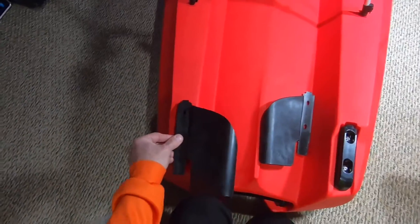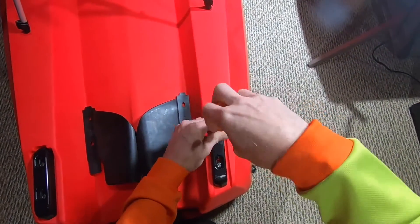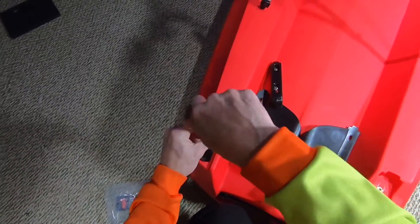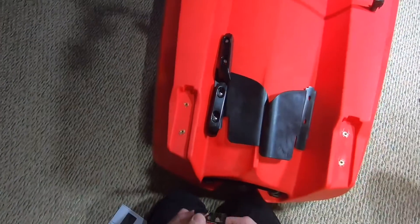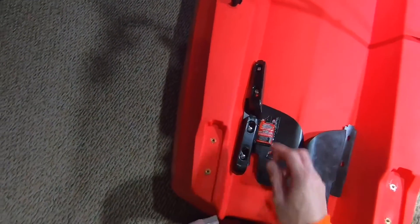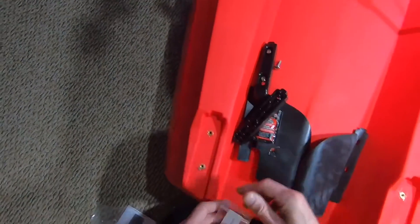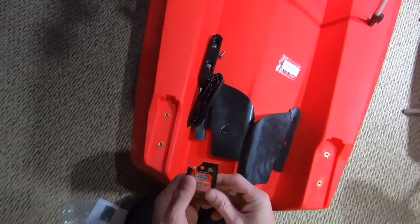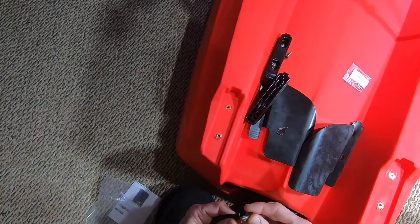The orientation of this is going to be just like this. So let's take off the skid plates. They come off very easily. So now we've got these off. I'm going to use some Never Seize. In the package they give you, it comes with longer screws. And I'm going to put some Never Seize on here. The reason for that is that sometime in the future I'm probably going to be back here either replacing the skid plates because they're worn out, or if I happen to break one of these.